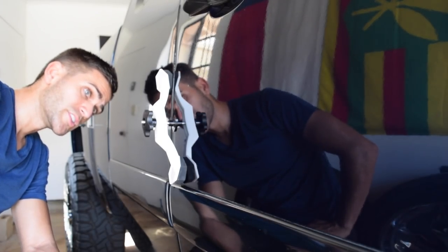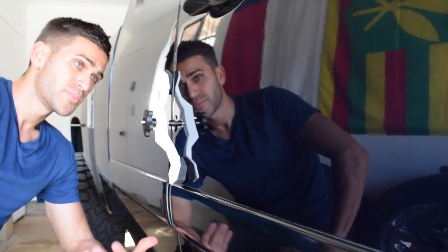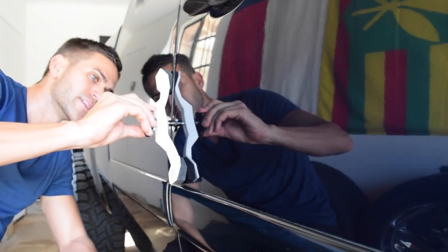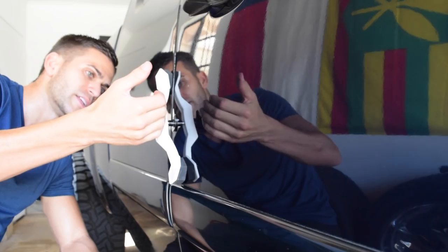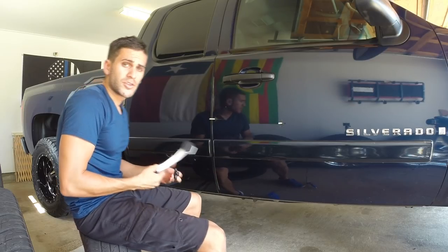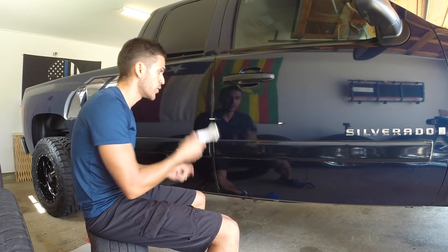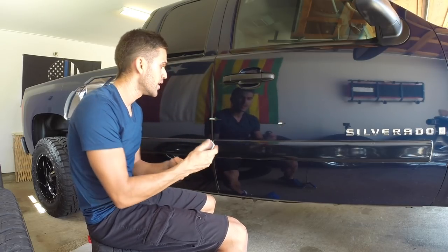What I really don't like about this bridge kit is the flimsiness of it. The structural integrity of the bridge itself just gives way every time you start cranking down on it. Just watching it bend is telling me that the dent isn't coming out — it isn't coming out. Something to look out for: these surface pads are real soft, but if you put them on the floor where it's dirty and then put it on the body of your vehicle and crank down, you will scratch your paint. Make sure the surface of these pads is clean before you apply and pull.